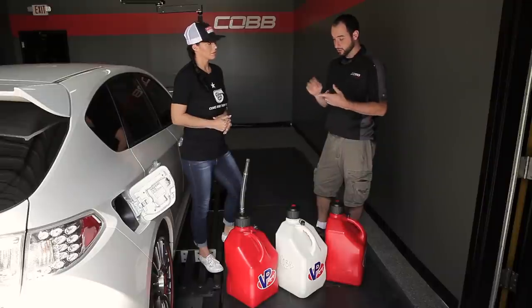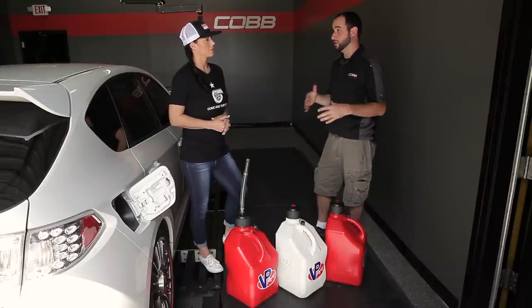Sure, absolutely. So one of the things people are a little unclear on with flex fuel is what can they run in the car? You know, can I run pump gas? Can I run E85? Can I mix the two? Fortunately, all of those are correct. You can do all of those things. You don't have to hit a specific blend of the two, and that's what makes it so easy.